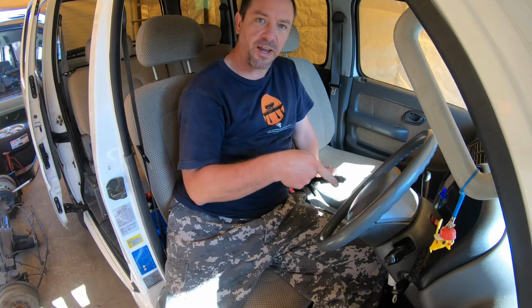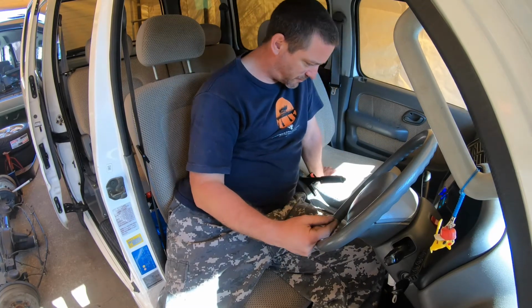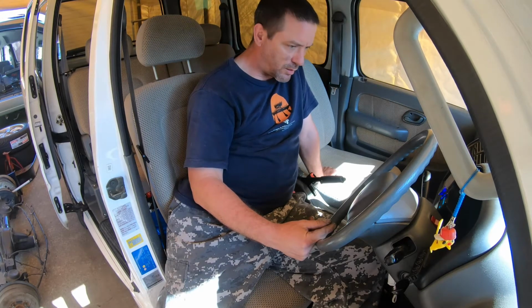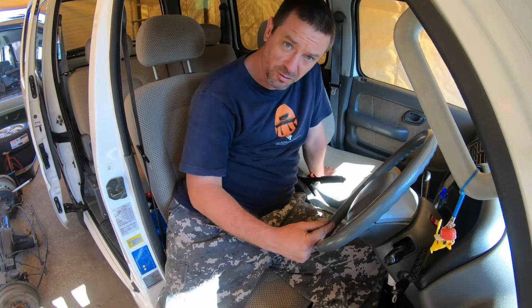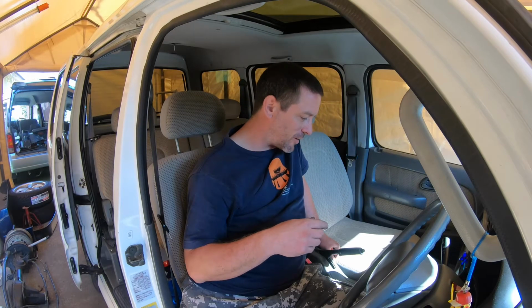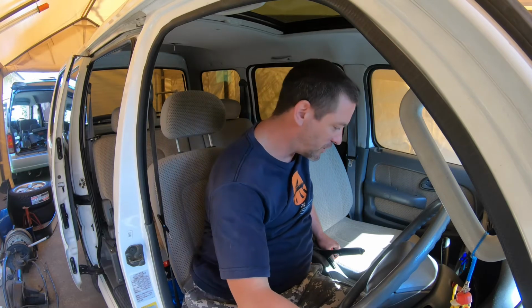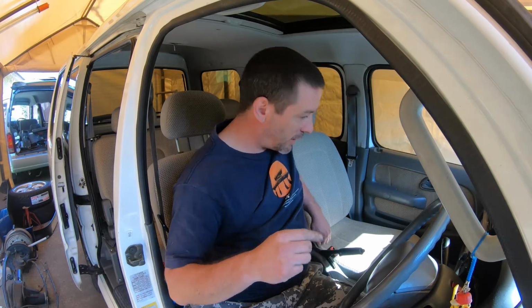Oh, no, it's spiked. Oh, it's sitting very high. Okay. Interesting. So it's still doing its stupid stuff. So I fixed nothing. Let's loosen off the bleed valve at the thermostat and see if that fixes anything, because at the moment this is a fairly high point. Driving it round might help too. We're not even at temperature yet and it did that. So let's just do that.